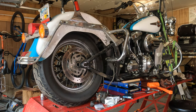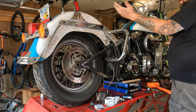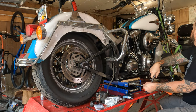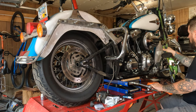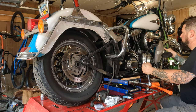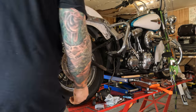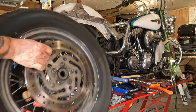We're going to have to jack the bike up higher. We're going to adjust our ratchet straps first — loosen them up a little bit — and then jack the back end of the motorcycle up. As I'm doing this, I'm being mindful of the tension on my ratchet straps. And from there, I'm going to scoot the wheel right out of there.